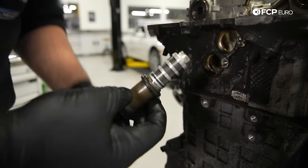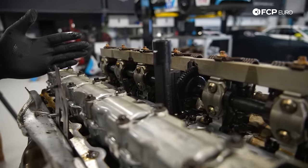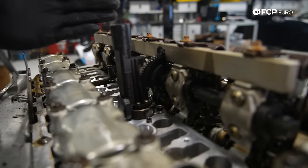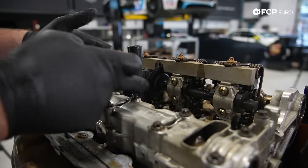And that one is clean as well. So the N55 engine had the latest version of Valvetronic when it came out. Unlike the N52 engine or the N53 that was in Europe, that had a separate Valvetronic actuator and sensor, on the N55, it's all integrated in one unit.